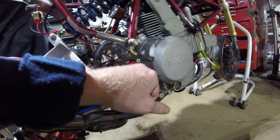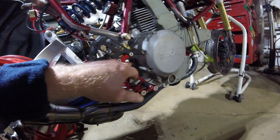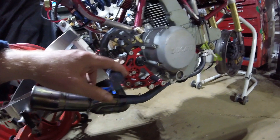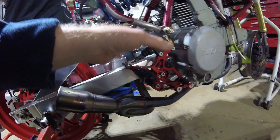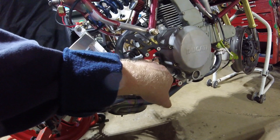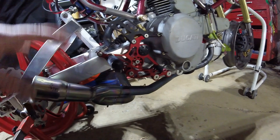Starting at the back — these are the Monster S4R rear sets I got from overseas. The longer Monster rear swing arm acts as an outrigger, bolted here, with a little helper that sits on the swing arm pivot which sits proud of each side of the engine case. It's very tricky especially when modifying and adapting, since this isn't an S4R engine. This cap shouldn't exert too much pressure on the rear set plate because the swing arm pivot is bolted solid to the swing arm and the bearings are in the case.